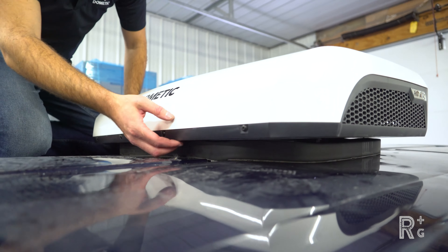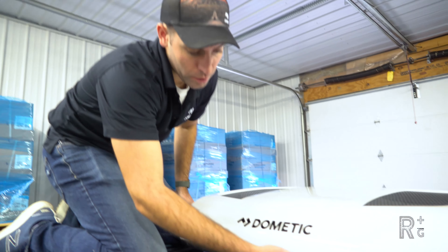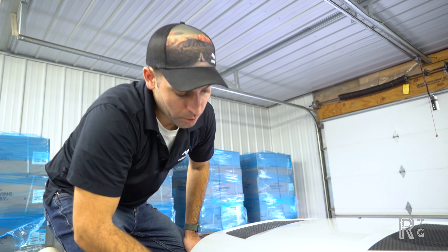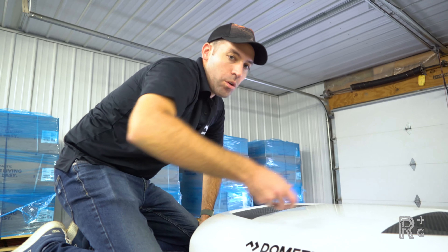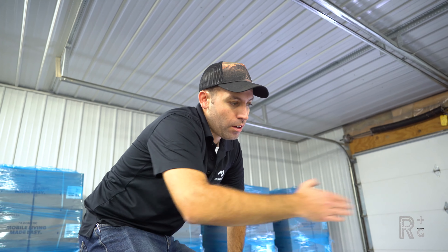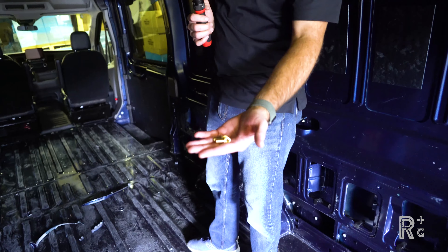Our dry fit is looking really good. One thing I want to point out is the condensate drain holes — there are four holes in the bottom of the unit, one here and one here in the front, and the same positions on the back side. You can see from our gasket position that we're a good solid inch and a half behind where those condensate drains are. It's very important to keep these free and clear, otherwise you'll get condensate backing up into the system and potentially overflowing into the interior of your van build. When putting the gasket down, guide it around the opening — keep it maybe an inch from the front, an inch from the back, and you can go out on the sides a bit more. We've got it about an inch and a half off each side and an inch front and back, giving us plenty of clearance to keep those condensate drains open.